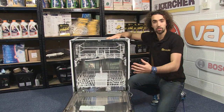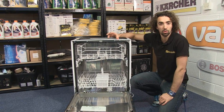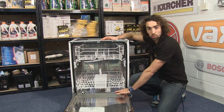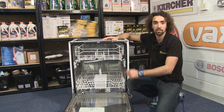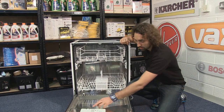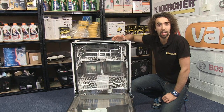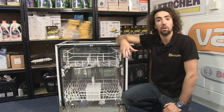When you've turned your dishwasher on and closed the door to start the cycle, the first thing that happens is the drain pump turns on. Any liquid that's run off the glassware or crockery into the machine is drained away, and that takes about 20 seconds. After that, the inlet valve turns on and the dishwasher starts to fill with water until it's just below the door seal. Once it's hit the correct level, the wash pump turns on and that's when you hear that familiar whoosh noise as the water is sprayed around the dishwasher. After that, the heater turns on if required, and shortly after you'll hear that familiar clunk noise as the dispenser drawer opens and lets the detergent into the dishwasher. Failure to complete any of those parts of the process will result in the dishwasher stopping and displaying a fault code. The rest of the wash cycle consists of washing, draining and heating, followed by the drying cycle.